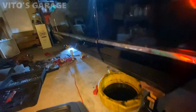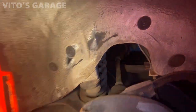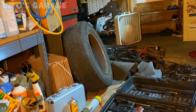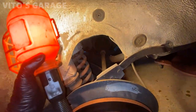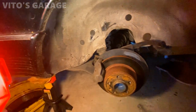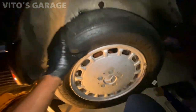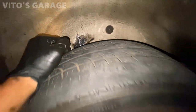The reason I removed the rear wheel is to check the brakes and everything else, but the main thing was something was rubbing. I want to swap the front and rear tires because the rear tires are in much better shape, so I'll put the better tires up front for now. This wear mark is from the bigger wheels this car used to have. This tire is pretty worn out on the edges - somebody was driving with low tire pressure for a while. I put grease in those spots for now just so it doesn't start rusting.